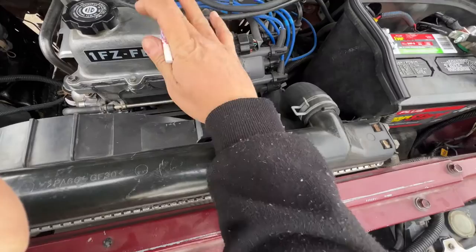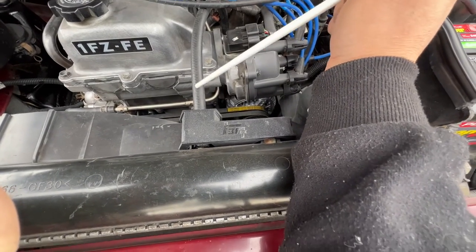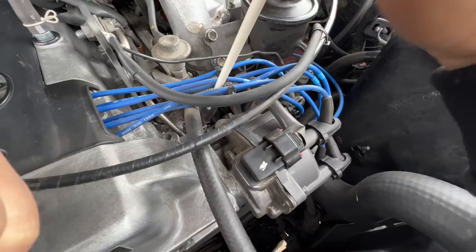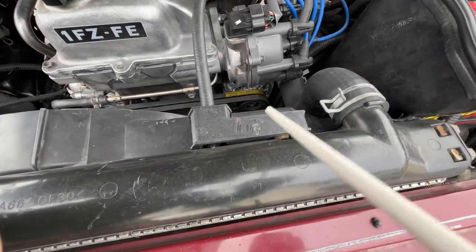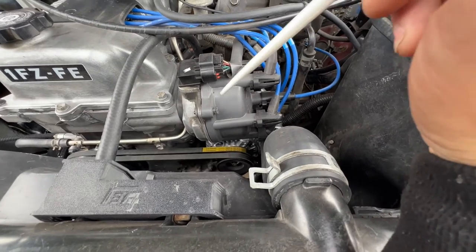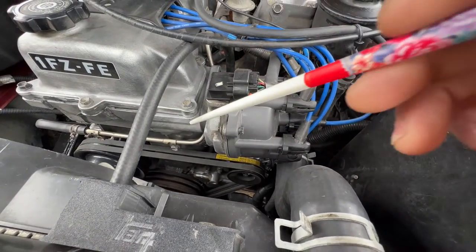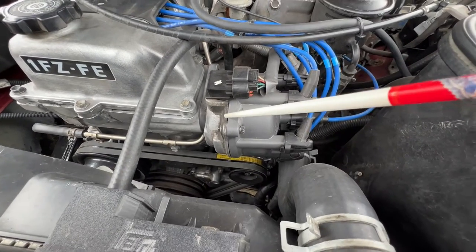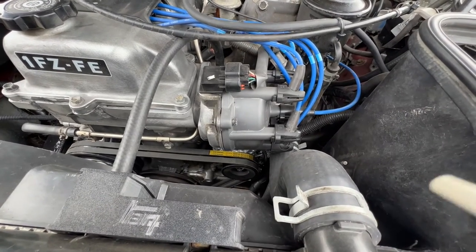Mine is actually broken but it's being held up with like a quarter-inch fitting right now. This hose goes up to the top coolant passage — it's the same coolant passage where this rubber hose connects. There's a metal nipple right there, so replace that. This aftermarket piece is a protector for that nipple, I got it on eBay. We have the distributor — this is the cap, and inside you have the rotor. On the shaft of the distributor there's an O-ring that's known to leak. So if you guys are having an oil leak right here, you might want to pop your distributor out and replace that O-ring — it's super cheap. But make sure you know how to do that, because you can't just pop the distributor out and plug it back in. It has to go in a particular way, and once you do that you also have to set your timing. So it's not a simple bolt-in bolt-out — make sure you do research on that.